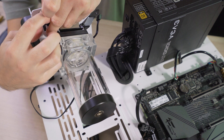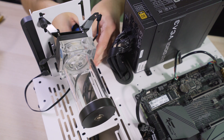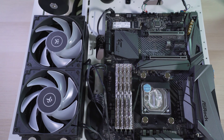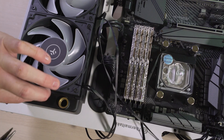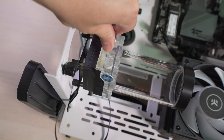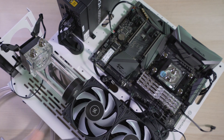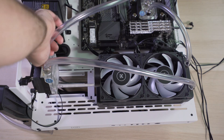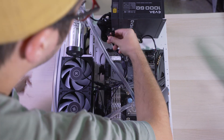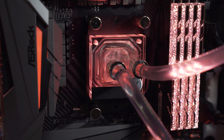For mounting your pump res combo there's no exact answer, but a general rule is to have it mounted lower than the radiator and installed securely. Place your radiator and fans into whatever position you want — we are almost there and it's looking clean. Let's screw the barbs into the sockets of each cooling component. EK was nice enough to mark the in and out on the block and pump, so put the tubes on the associated barb and work it on until it's tight, then carefully but firmly twist the compression fitting on. For the wires, plug all four of the RGB headers into the RGB splitter that was included, then plug that right into the board. The fans also plug into the splitter and then into the motherboard.